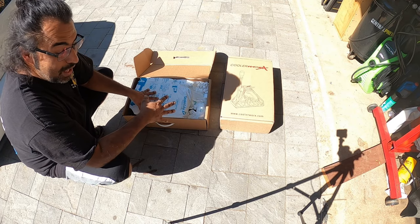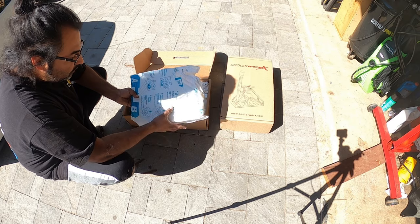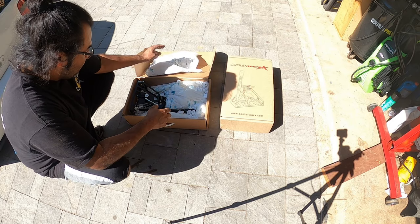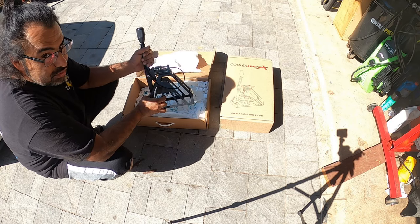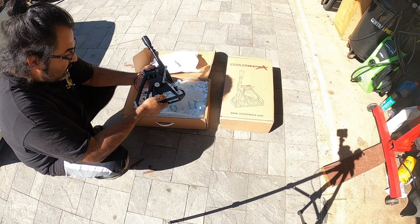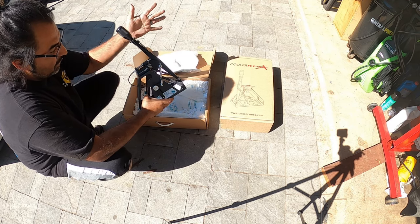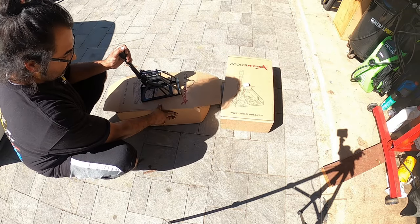One thing right off the bat: when I opened these last time the packaging is phenomenal. They use a proper shaped foam so when these go in and get pressed they contour to the device itself — very, very nice. This right here is the top mount for the Corrado. You are using an O2J shift box — remember that, guys, for an O2J, not an O2M or O2A — so the five-speed transmission. They've got the reverse lock-out here and then left/right and front/back movement.